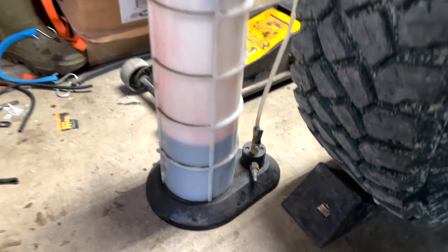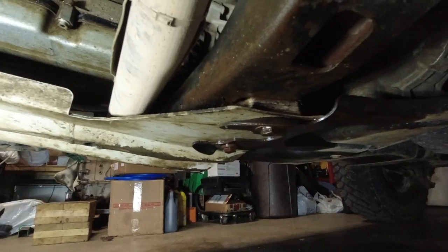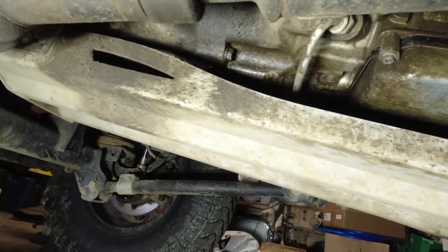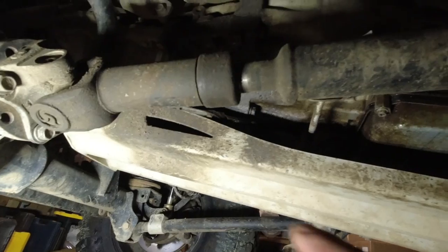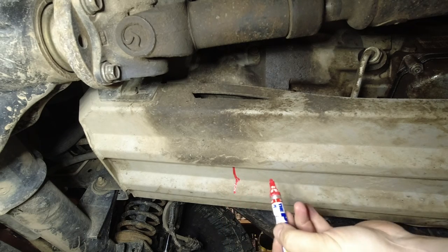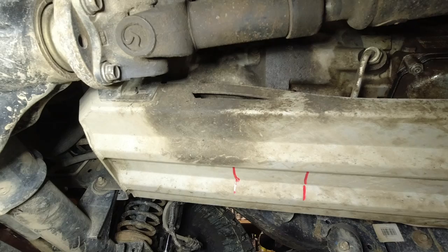I'm actually pleasantly surprised - it pulled out about three liters which is really good, which means that's three less liters that's not going to end up on my face or making a mess underneath when the oil pan is dropped. Going underneath to show you guys the mess - that transmission pan is leaking like a sieve. I need to mark where I can cut an access hole in the skid pan, so I'm just going to mark the pan roughly where I want to be to cut my access hole that way I can put my hand up and get at it.